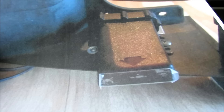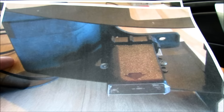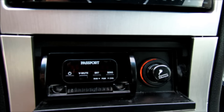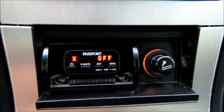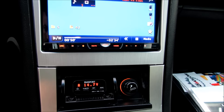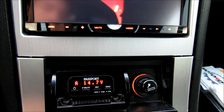Now the 8500 CI — here's the installation of it. As you can see, it's very stealth. I have the Nismo front bumper on, and the OEM bumper has this plastic thing with foam around it as an insert. With the Nismo bumper there was a lot more room. I just took the foam off this insert and then screwed the detector into it. Whenever cops are radaring you, the radar is shot into the very front of the bumper anyway, so this is a more efficient place to put the detection unit than on your windshield. Here's the little start sequence when it starts up.